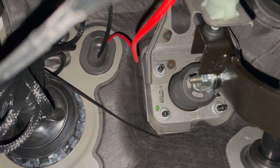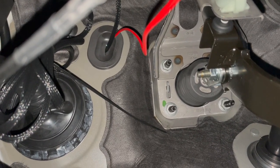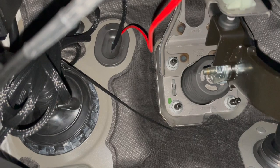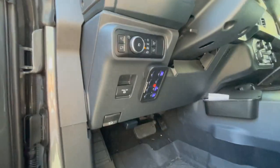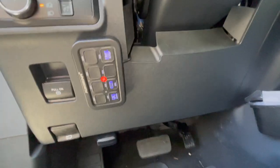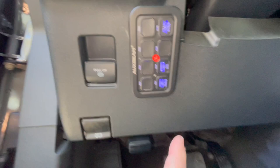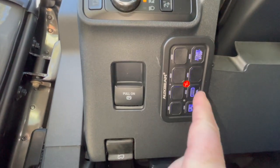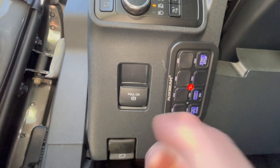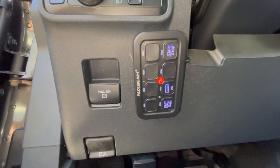The red accessory wire coming out of the grommet is fused to the panel on the inside of the truck, so when the truck is off, the lights and aux beam don't get any power — no battery drain. The black wire goes to the actual controller unit, and I found that's a pretty good spot using some double-sided Velcro. Right now we have the DRL which is the low beam, and the high beam which is the cubes. Everything else uses the blank switches that came with the kit.